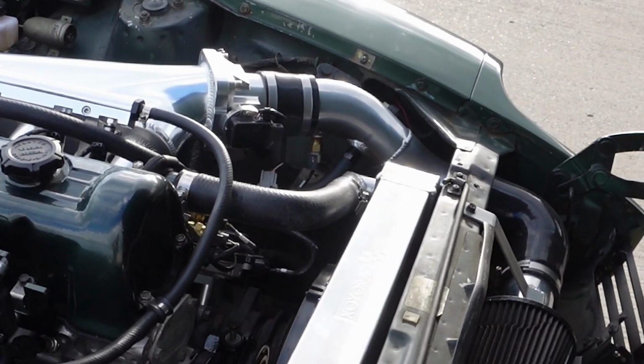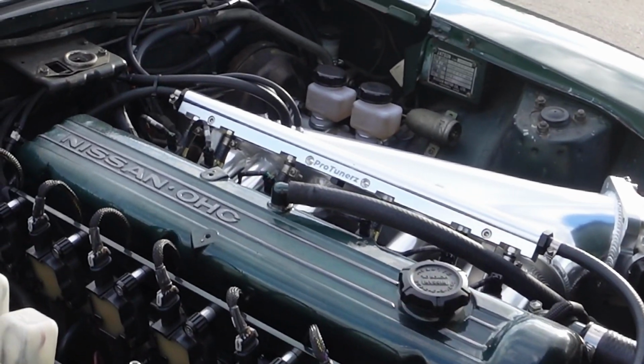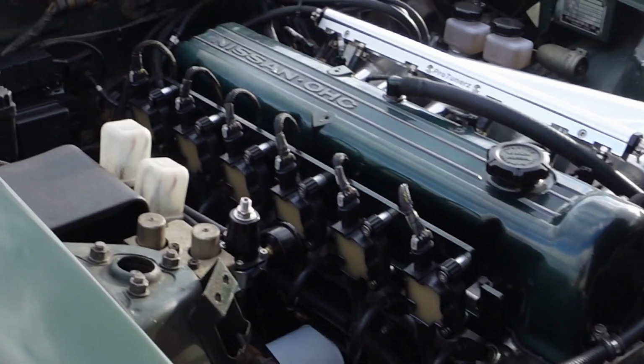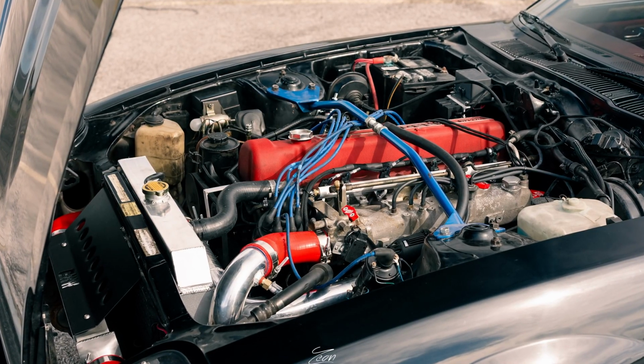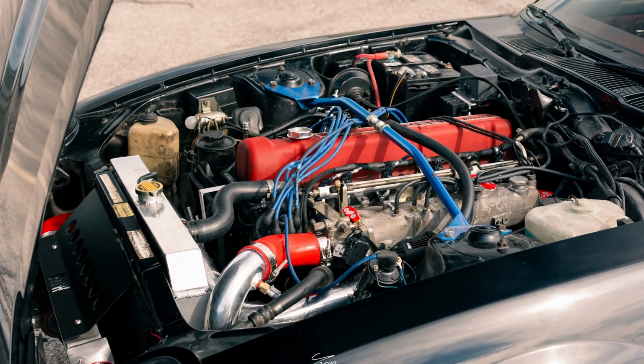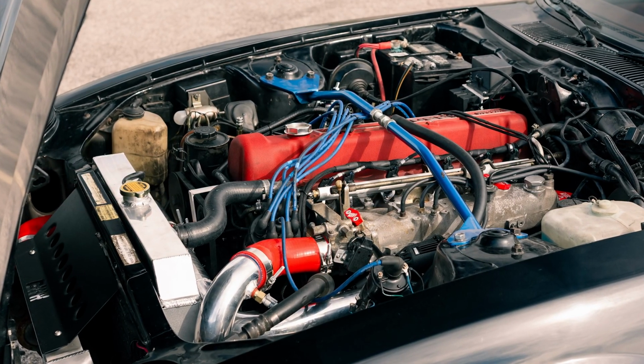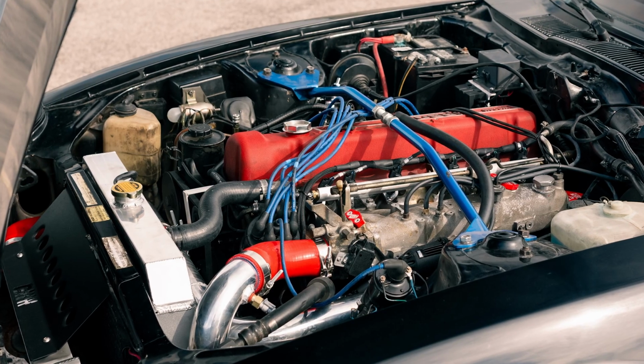The intake air temperature sensor for all naturally aspirated vehicles can be mounted in your intake pipe anywhere within 12 inches of the throttle body inlet. The same applies for all turbocharged vehicles, but it is especially important to make sure on turbocharged setups you're on the cold side piping or post-intercooled piping, as this will be the most accurate reading of the air temperature entering your engine.